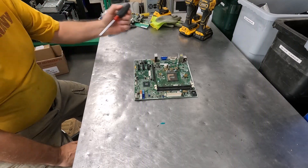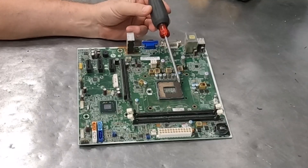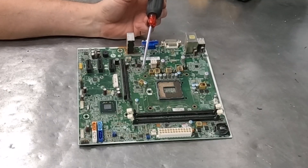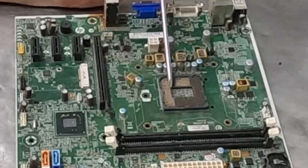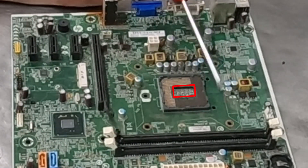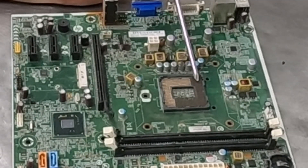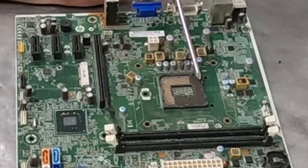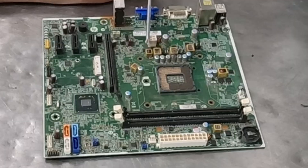We're going to start with this board first. The first thing we do is look at the socket. Now even though the bracket clamp is missing, we can still identify this board with a little bit of sleuthing. The opening of the socket in particular is rectangular, relatively large size, and there's no hinging mechanism on the plastic. That suggests the hinging mechanism used to clamp down the CPU was part of the metal bracket that is now gone.